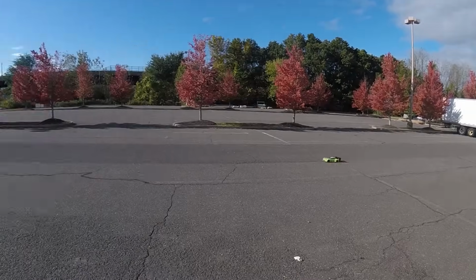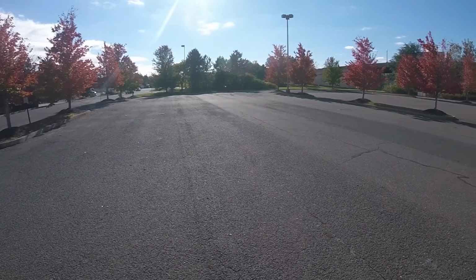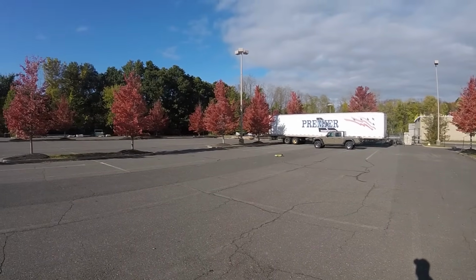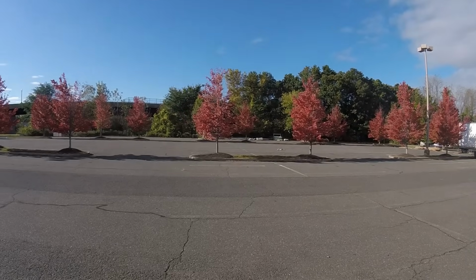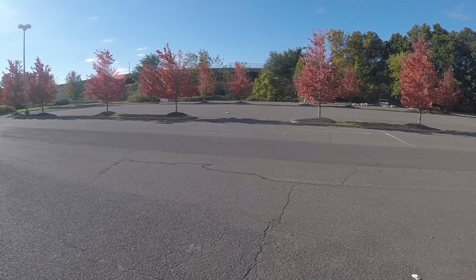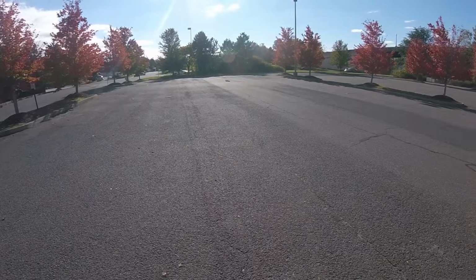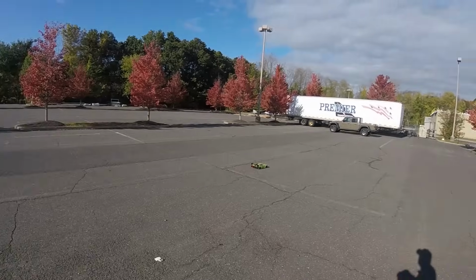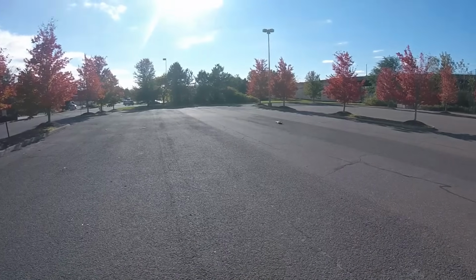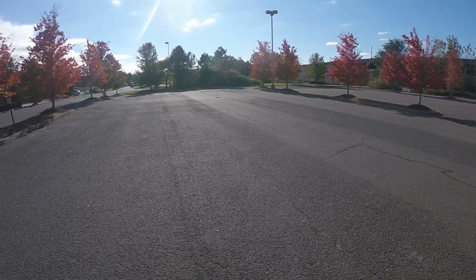But one thing I noticed, this thing really plants itself when you're at full throttle. Some garbage over there, keep hitting it. But man, that thing is quick. Around the lot here. Whoa. Got a lot of body roll in the corners. As you can see, it comes out of that corner there. It wants to roll out. Might have to do a little bit of camber rod tuning in the rear. But if you're just doing straight line rips, I think you're good. Look at that. Plants itself and it just takes off. Definitely need some runway for it though to get this thing up to top speed.